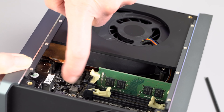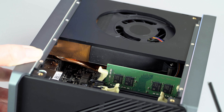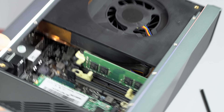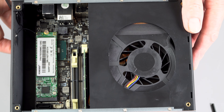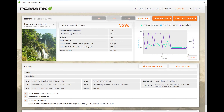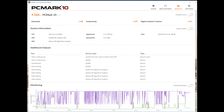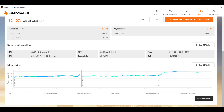Inside, it's a little hard to see unless you thoroughly take it apart, but there is one nice massive copper heat sink and some heat pipes as well. The fans may be more aggressive than necessary — the single 90mm fan spins up harder than it needs to — but the CPU and GPU temperatures are just fine. Compared to a competing laptop with the same form factor constraints, temperatures are similar: CPU worst-case benchmarking and gaming hits the upper 80s to low 90s Celsius, and the AMD GPU runs around 75°C.